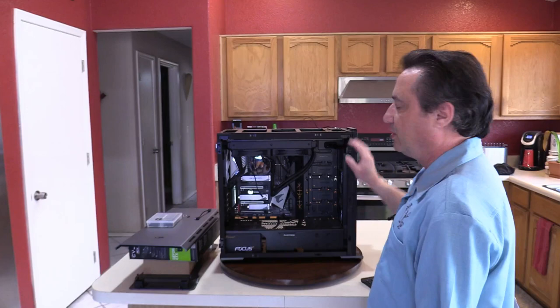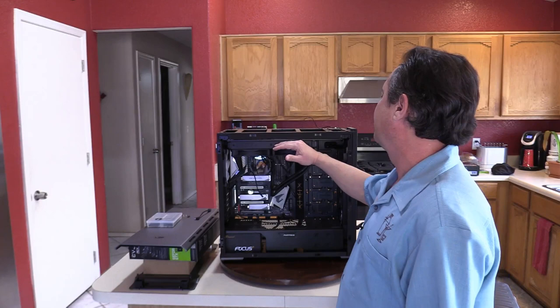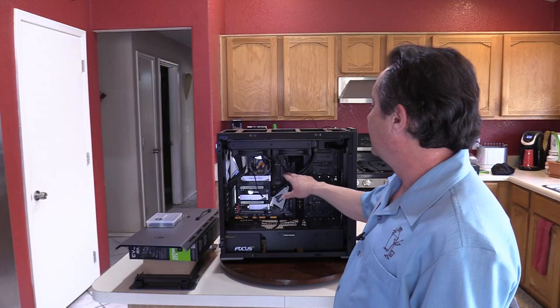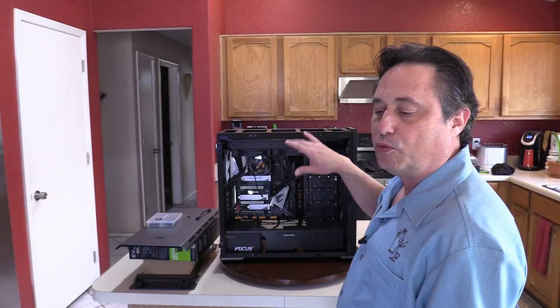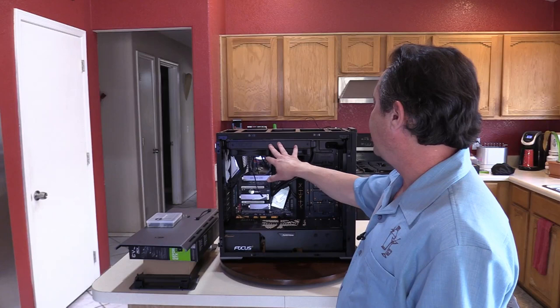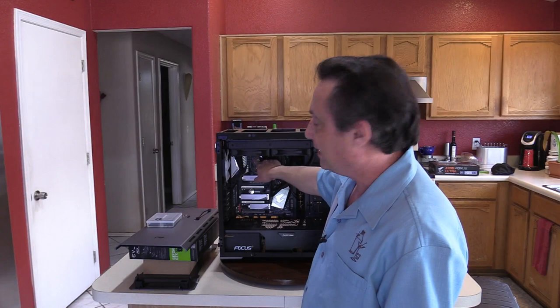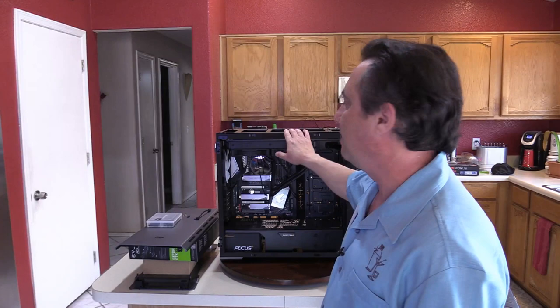As you may or may not be aware, we ran into a few obstacles regarding the cooler overlapping the RAM, the size of the RAM because of the RGB, then preventing a liquid cooler from going in, or even the Scythe Mugen 5 would barely fit. So we replaced the four sticks of RGB RAM with normal RAM, two sticks of 16 gigs each instead of four sticks of eight. And we've installed the Kraken X62 on here. And we had a little issue with the USB connector because the USB connector plugs into the water block on the X62 and then it hits the fan blades because Phanteks did a terrible job in designing this case. And I cannot recommend this case.